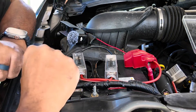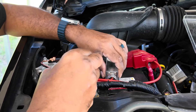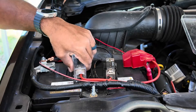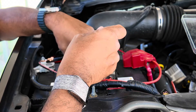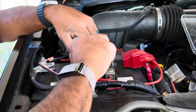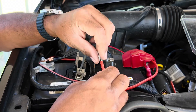The 12-volt power going to the West Mountain unit is directly connected to the battery, connected with these Install Gear fuse holders. I've done something wrong here — I've connected these fuses without ferrules. What's the difference? When I was younger, I'd whip one together real quick, twist the wire, and wrap it around the screw. Well, it chews up the wire. It doesn't provide as much surface contact, and it's just generally not as neat an install. You can see what that screw does to the wire.